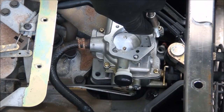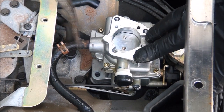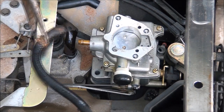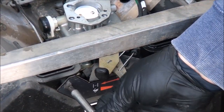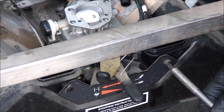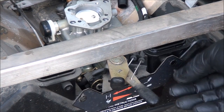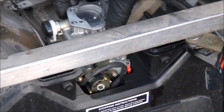Remember, don't lose track of that wire. I'm going to take that one out and go ahead and take off the fuel line. It doesn't look too dirty so far, but it doesn't take much to plug up these little carburetors. Now we're going to have to figure out how to disconnect the linkages here. I think I need to move this throttle mechanism in front. Looks like there's an electrical component back here on the carburetor. If I remove this piece, that definitely gives us some more room to move this carburetor around.